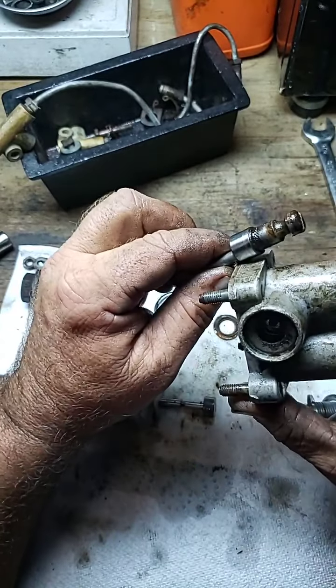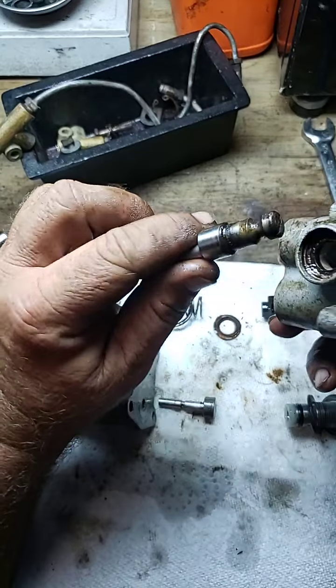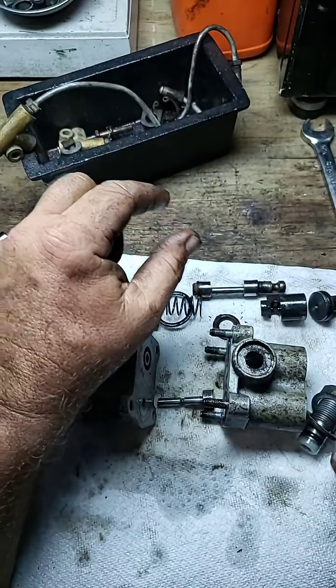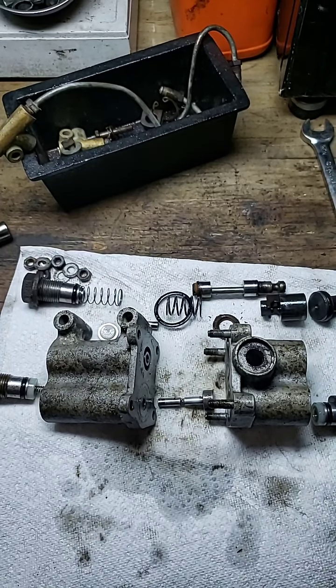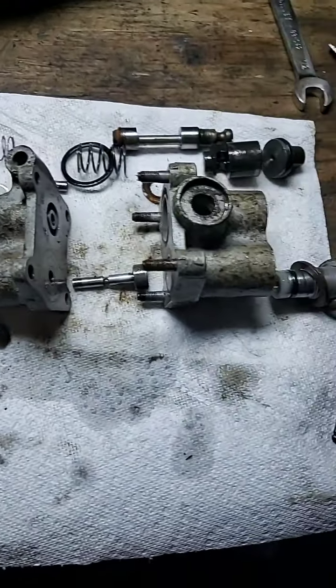There you go — this is all going to get cleaned up. There are o-rings here that will get slid right back together when we reassemble. In the meantime this all gets cleaned, and we'll have to wait for the gasket kit to rebuild it along with the plastic spacers. This height controller will look brand new when we're done. You're probably never going to see this again — nobody's taking apart 50-year-old Rolls-Royce parts like this height control underneath the trailing arms. Mr. Sunshine, Rolls-Royce technician Eddie, coming to you live from sunny South Florida. Thank you for watching.